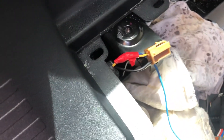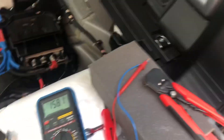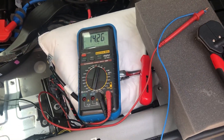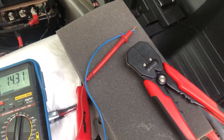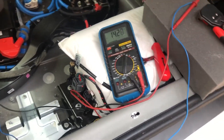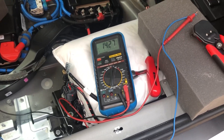I've got the lead wire soldered in now. Just hooked up the battery and checking we've got 12 volt on the blue wire, which is what we're going to need when we turn it on. We've got 14.26 volts — negative hooked up over there, positive on the blue wire. You will notice because it's got air compressors in them for adjustable height they will spit some air every now and then — that's normal.